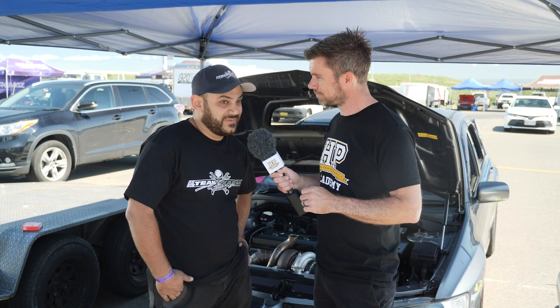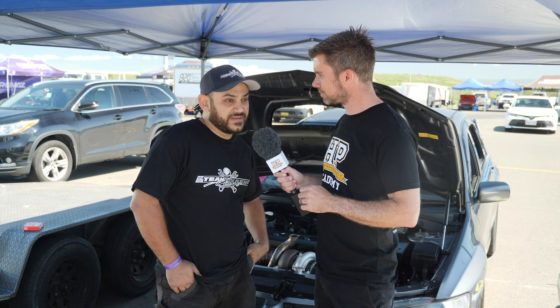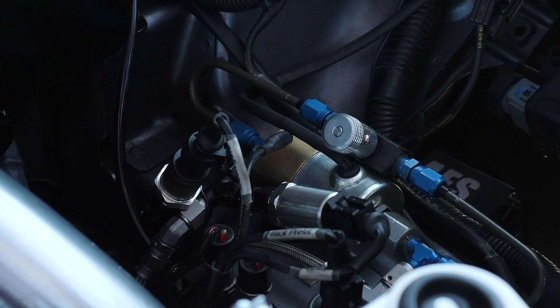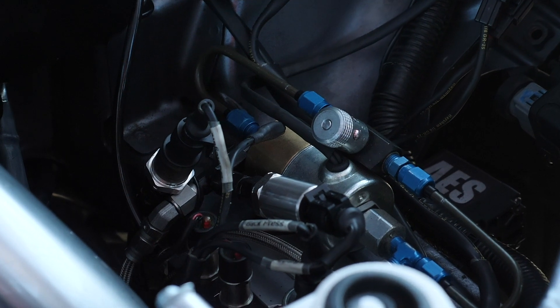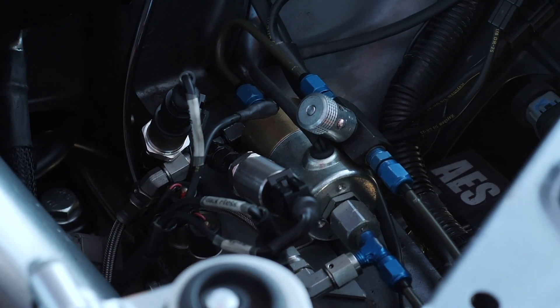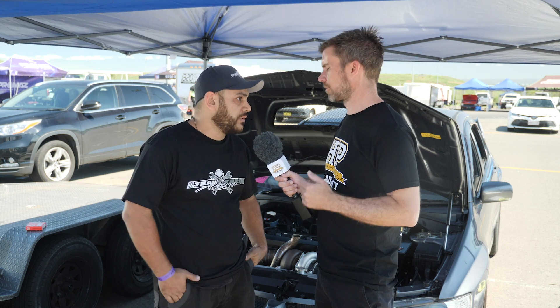It's probably the most hardest thing to get out of the hole with a four wheel drive car. We run the Magnus slider on this car. It does help dampen the car on the initial hit — it's pretty much just riding the clutch out of the hole for you, that's the whole idea of it.